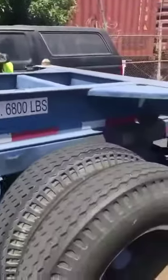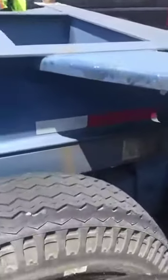Going down, if I follow those Airlines, it leads me to my brake chamber. My brake chamber is tight and secure with the full set of nuts and bolts. It's not dent, cracked, broken, or illegally welded, and I'll be listening for any air leaks. The Airlines leading to my brake chamber are tight and secure at each end. I'm checking for any cuts, cracks, or bulges, and I'll be listening for any air leaks.